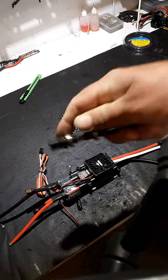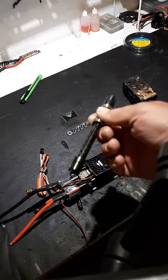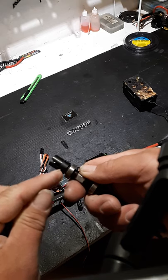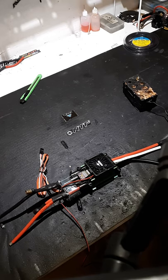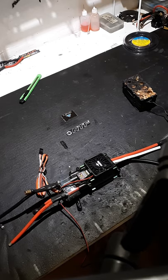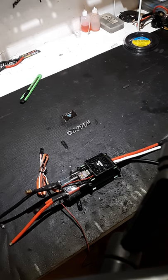Here's another thing - the spools. I've had a lot of people ask. Here's the spools I sell. See that little rubber O-ring? You have to have it in between the cup and the bearing, or else it will hit on the diff carrier. Alright guys, God bless you, have a good day, good night, be safe. With all this virus stuff going on right now, just try to be safe. Take care of your family, stay humble. I'm out. God bless.